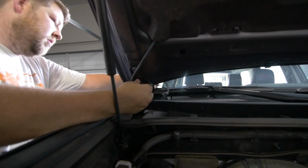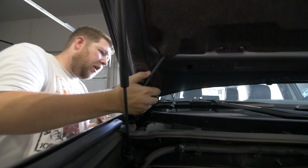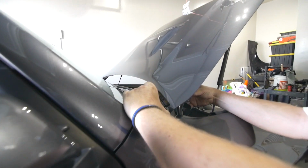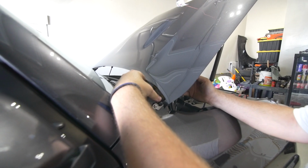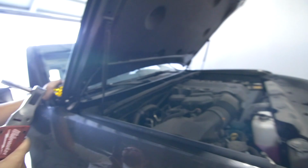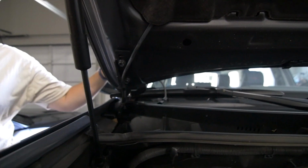So how do you know how to adjust it front to back? It's slotted so that it'll also fit the Lexus GX models. Just want to make sure it's going to clear the windshield wiper. So I move it up a little bit more forward, or as far forward as possible. It's up all the way. Yeah, you still got some clearance. That's easy. And this guy can go back in. Pop that back in, and then we'll just run the wiring.